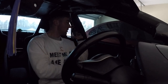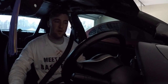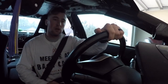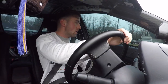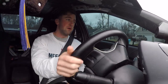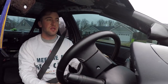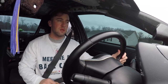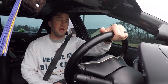I finally figured out what's wrong with my car. The issue was actually the clutch. At least that was what was causing it to drive weird, accelerate weird, feel like it had no power, and the RPM fluctuation — all of that was linked to the clutch. My clutch was completely burnt out. It was a stock clutch I had put on at 40,000 miles and it burned out at 68,000, so it lasted a good 28,000 miles. I got an ACT HDSS clutch and an ACT streetlite flywheel.